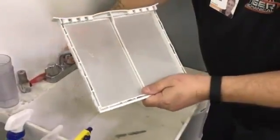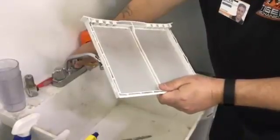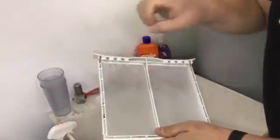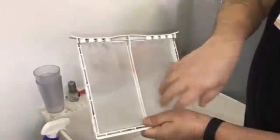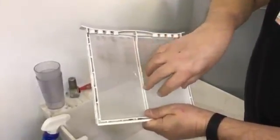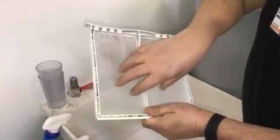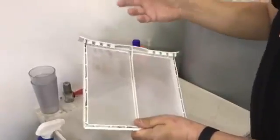As I showed you, this looks like it's clear, but the trick is — air has to go through this. The dryer has to breathe; it has to exhaust all the air and clean all the lint so the lint doesn't clog your venting system in your house and your exterior vent. So we're filtering the lint out.